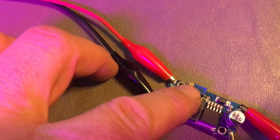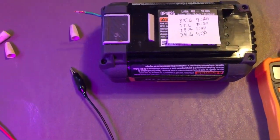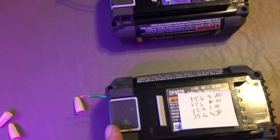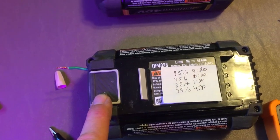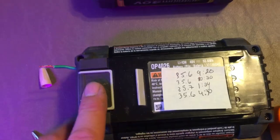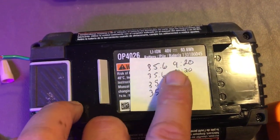After a little more research I found I could adjust the screw counterclockwise — it takes multiple turns. I had it hooked up to the voltmeter and as I turned the screw I could watch how much more voltage was being supplied. I ended up successfully charging these batteries and did reach over 30 volts, which is the minimum for these chargers to take a charge.